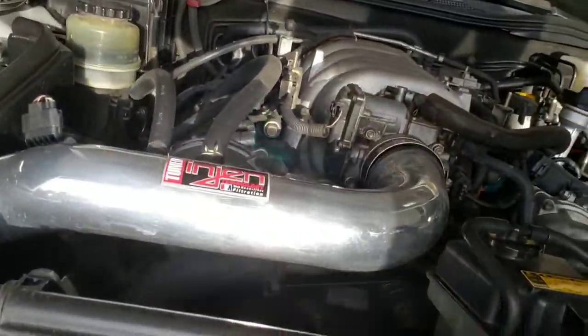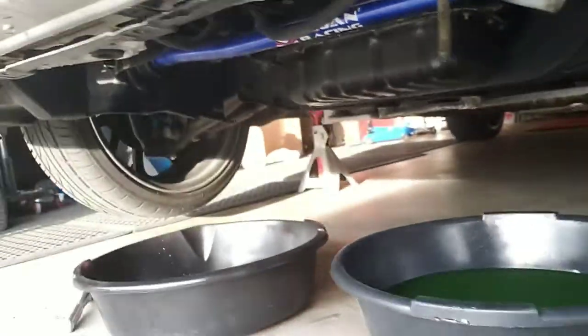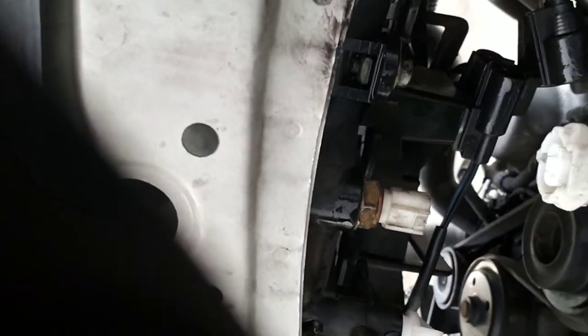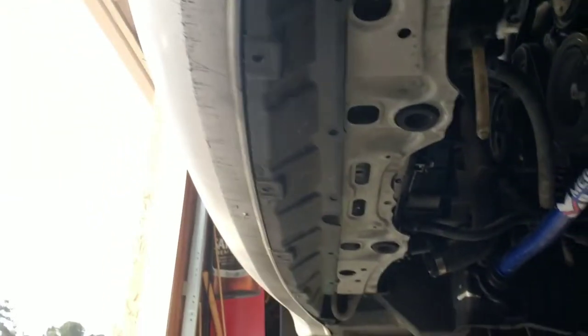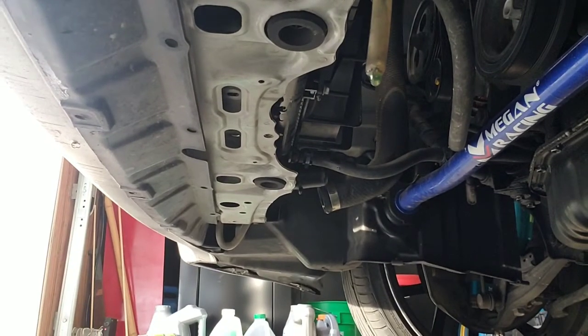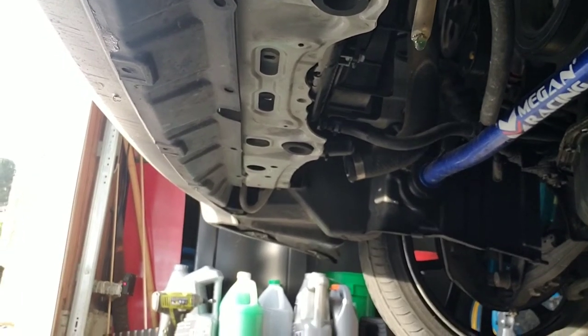There are plugs up here I'm going to unplug right now. I disconnected under this, drained the coolant with the little drain plug right here. There's three plugs — that white one and those two up there — just simple plugs, just unplug. I unplugged that last hose and I'm draining that into a second bucket. Those two lines I'm pretty sure are for the transmission, so I'm going to be very careful, maybe use a nut to plug the end and crimp the hose.